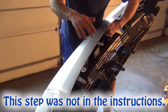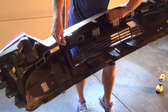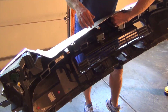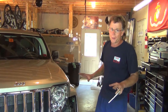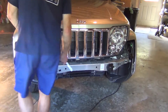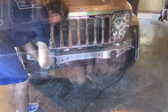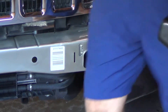When you're pulling the bumper back to get to these lights and disconnect them, you may have to push down on the tabs. We were able to get ours out without a problem. Moving on to the next step: it's a very hot day to be doing this, but the next step is we've got to take these two caps off. Again, we'll be using a 10 millimeter socket to remove them. And the second cap is off. Moving on to the next step.